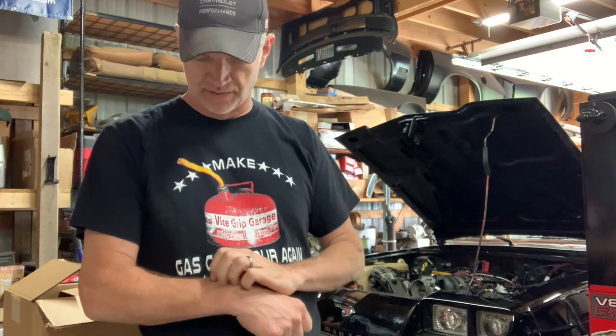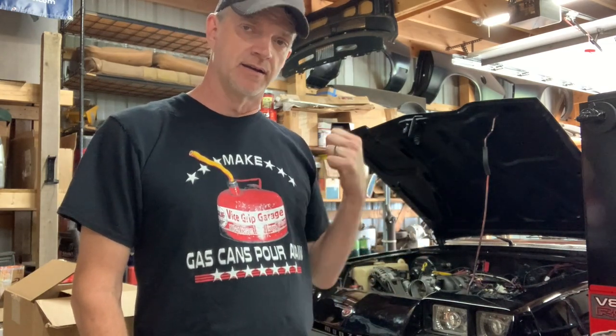Now, I've done that. I haven't fired the car up yet, because the other thing we checked was that we knew we dumped a ton of fuel in the car. You could just smell it, super rich, and it about smoked us out of the garage. So we checked the oil. Oil smells like gas, not surprisingly. So I'm not going to run it with washed out oil. I'm going to give it an oil change real quick, come back, then I'm going to fire it up.